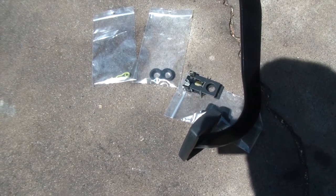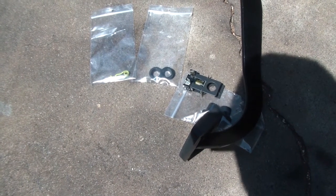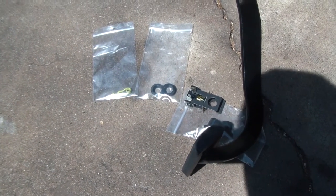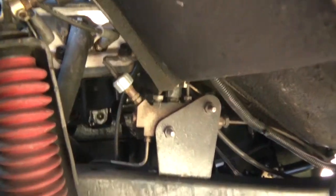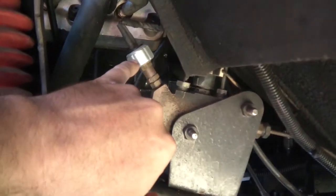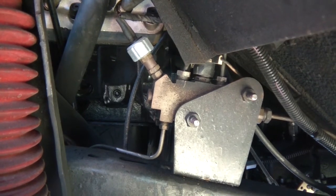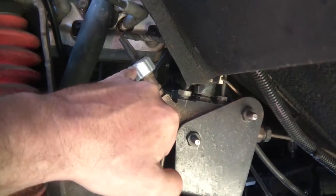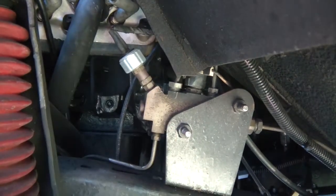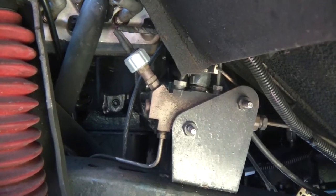One of the issues I'm having is I did a four-disc conversion and installed a hydro boost bracket and hydro boost, but it's just too powerful for this pressure switch. That thing there is the proportioning valve, and that little pressure switch keeps on failing — like every month or two, maybe every three months it fails, and sometimes it actually blows out and leaks.